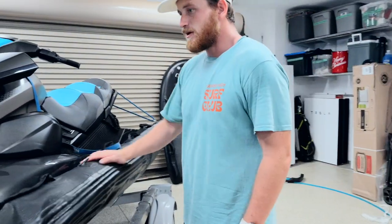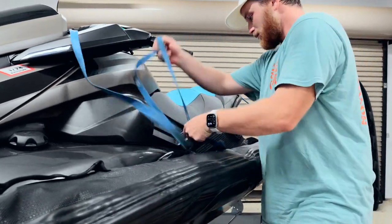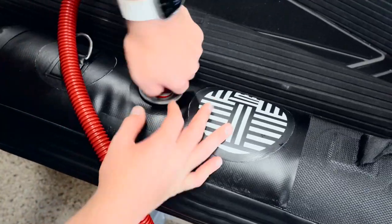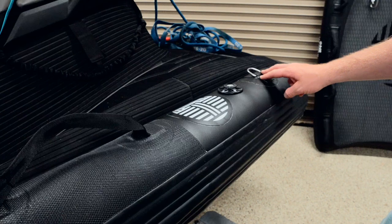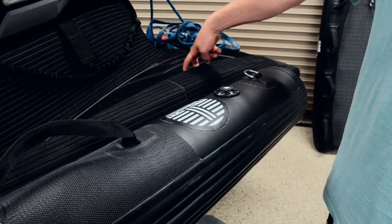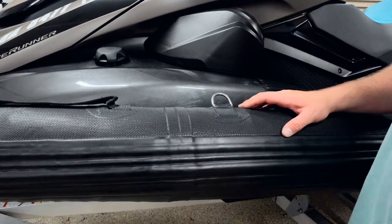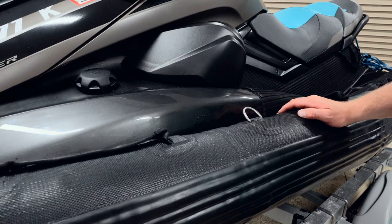All 50 bolts are now in the bottom. We're just going to undo these straps we had tightening the top, and then I'll untie the rope on the back, and we're going to inflate the pontoon all the way up to see how it sits. The last step will be to hook up straps to these rings and install the little bolts in there. The straps you tighten prevent this from moving — you have one here and one up in the front. Every jet ski is different, so measure it out carefully.